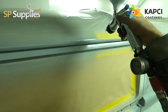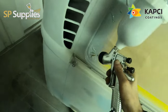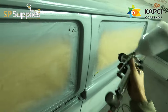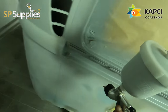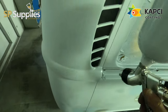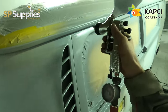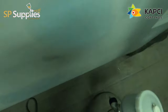I wouldn't say slow applying here because this is going on really thick and heavy — I want a good build so I can basically DA and hand pad all these edges with a 400, and try my best not to break through to anything other than the previous primer, then prep it ready for paint. It is already painted — after voicing over this video I've already got the paint video edited, which I'll be dropping midweek.